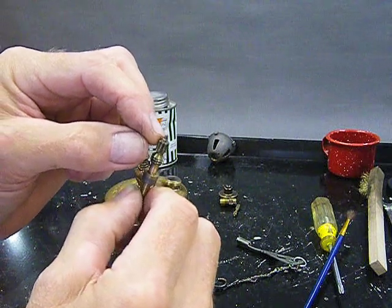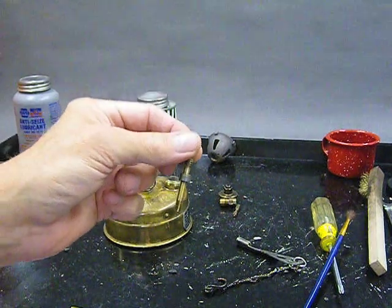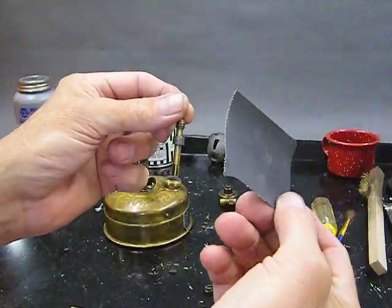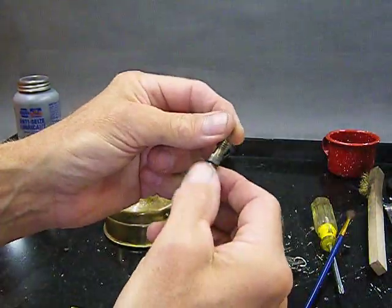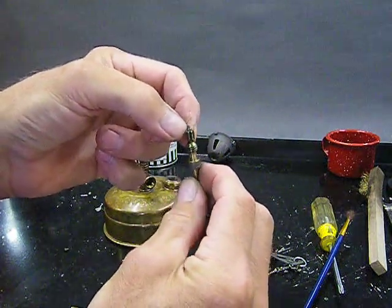You can maybe try steel wool, but I don't think that'll do it. But 400 grit, wet dry, that's the black stuff. Here, you have a piece right here. Yeah, like this stuff. This is cut up; it comes in big sheets. But polish that up a little bit, and then take some 600 and really make a nice polish. But you don't want to have burrs there.